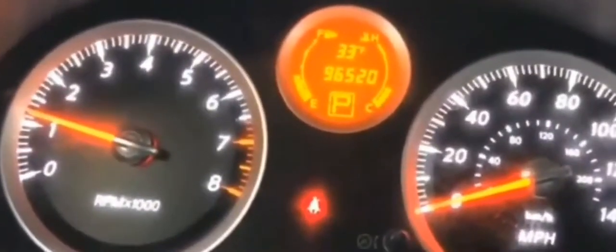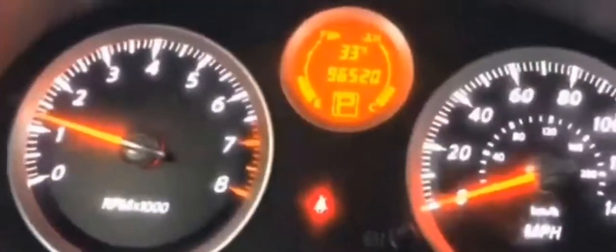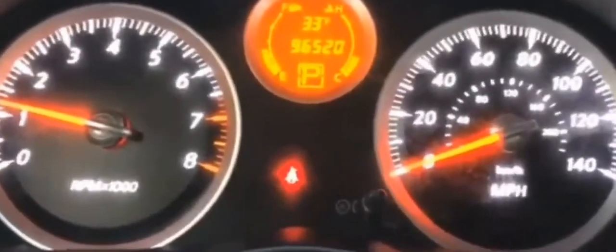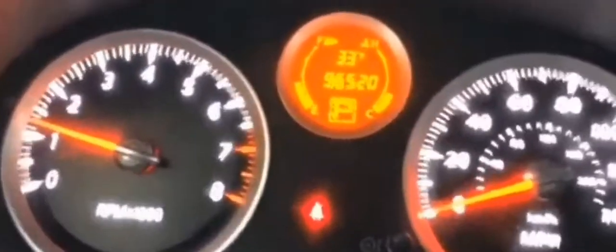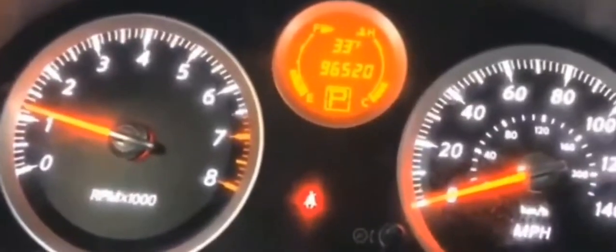So the third thing to check in this situation is to see whether your fan belt came off, to see whether your serpentine belt came off, and that belt is connected to the alternator. Obviously, it drives the alternator. The alternator is the part of the car that actually charges up your battery. So obviously, if the belt fell off, your alternator is not turning, and your battery's not being charged, and you could be driving on your battery for a good while, and then your car dies because your battery is dead.